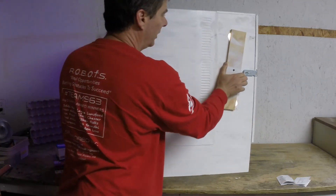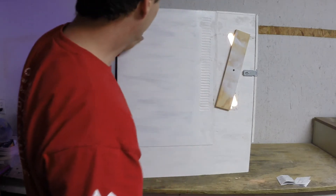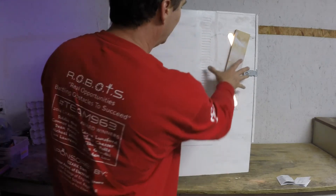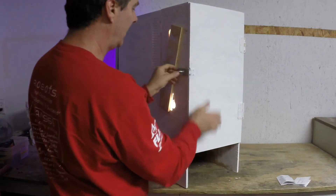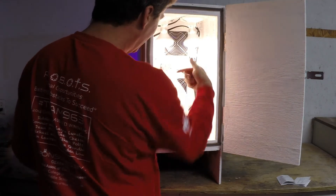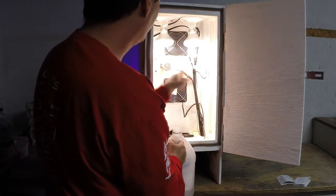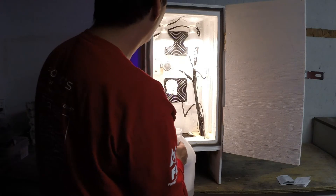The sixth control is the amount of fresh air that comes in and out. The original refrigerator was cold up to this zone and then this was the hot zone back here. We are circulating air with those fans between the two zones — the front and the back — and we enlarged the back so that we have a working room back here. The bulbs are heating, so we've got redundancy: it can run on one bulb if one burns out, and the same with the fans — if one fan burns out it will still circulate air with the remaining fan.